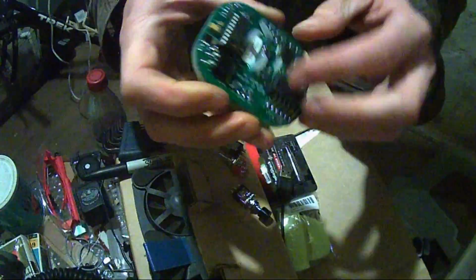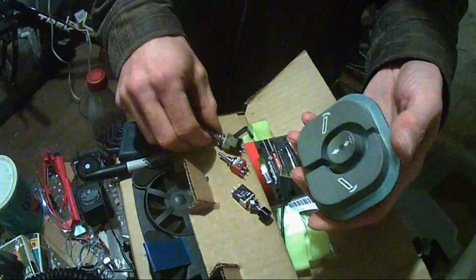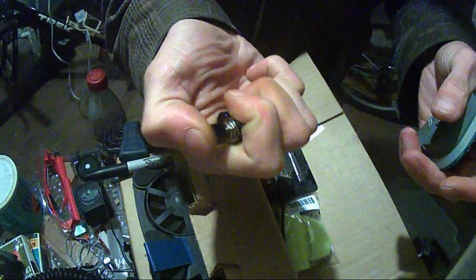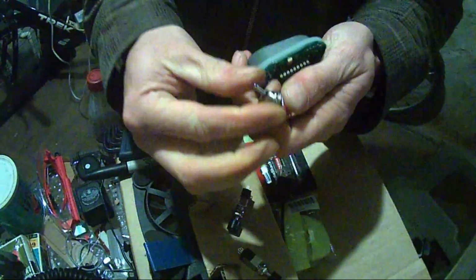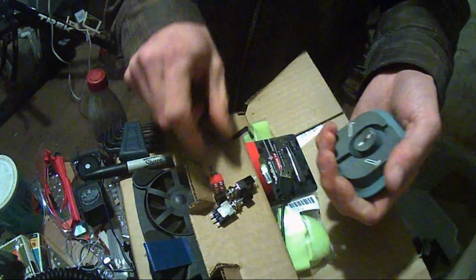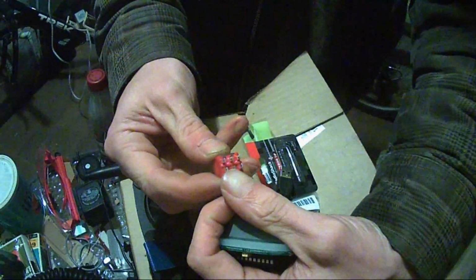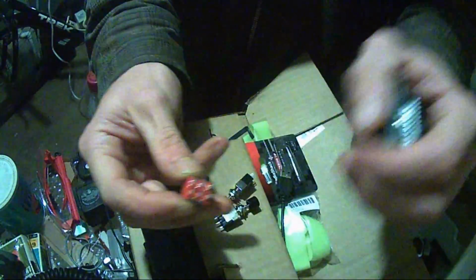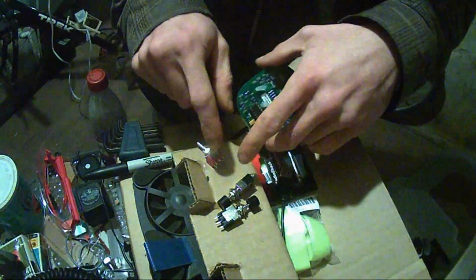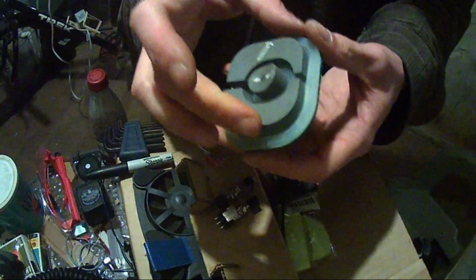Now what we're after is they've got it hot glued in here, and work this pad off of there. Put a button and another button and this 2-position momentary switch. These are all momentary, and this will allow me to connect these two here and the opposite two here. The ground won't be bridged, so that if there's any silly grounding going on in here, it won't be messed with. All 4 of these will act just like four of these contacts being closed on this.